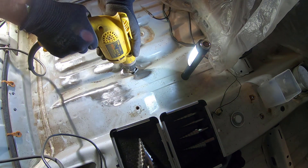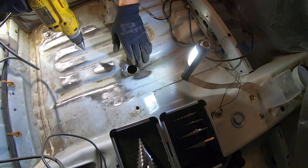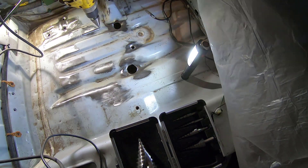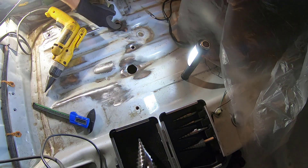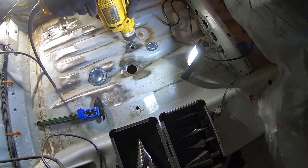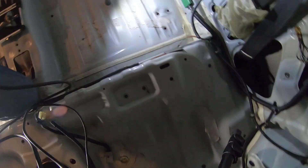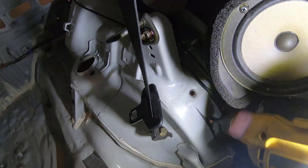Using the taper bits to straighten out and clean up the holes where the harness was tied down. There were two larger holes that had actually rusted out — they were originally very small but had big steel washers on them that rusted out, making the holes bigger. Those needed to be cleaned up. I used the factory Honda floor pan plugs that you can see in the floor pan. For the smaller roll cage hole that wasn't rusted out, and where the roll cage was bolted in the corners and the rear wheel arches, I drilled those out to 12 millimeters and used plastic factory plugs.